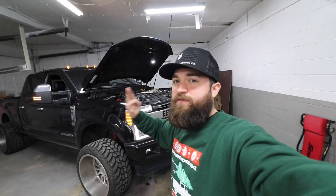Personally, I never take the truck off of power level 5 — I know that sounds crazy. But I've hammered it on this channel: 85,000 miles on the truck, hammered it all 85,000, and now we're hammering it at 720 horsepower and almost 1,400 lb-ft of torque. These trucks are pretty tough. There's the first drive on the new tune — a safe and reliable 720 horsepower. I'm super addicted. Next steps would be a compound turbo, bigger single, bigger injectors, or nitrous, but then you're talking built engine, built trans.